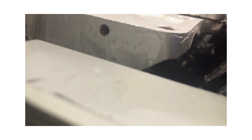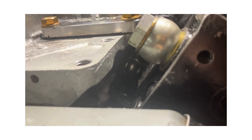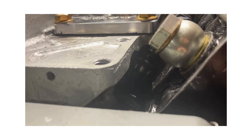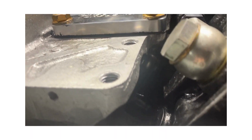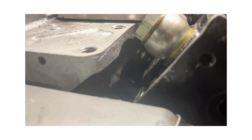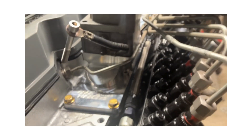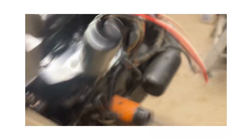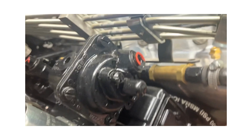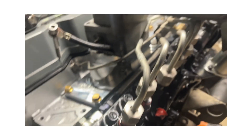What you need to do is run a banjo bolt there — you can see it right in there. This banjo bolt here is the fuel return, but the oil delivery is in there. A banjo is pretty much the only way to go because it's so tight with the 24-valve head, and you still need to shave the head down a little bit with a grinder to squeeze it in there. That's where this line is running right up in here. That's just the way you want to do these P pumps for oil.